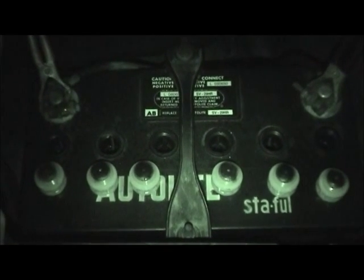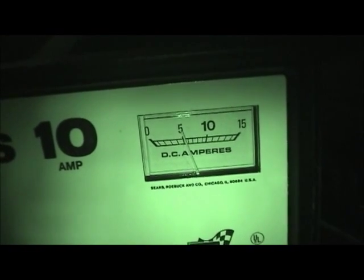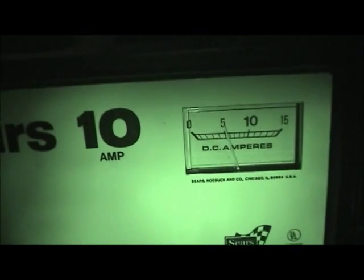That's pretty easy to see in this particular case. Had I not have these caps off of here, or if this were a maintenance-free battery where you can't take the caps off, you might think that this thing's in pretty good shape, because it's taking some current, or appearing to accept a charge. It's running about 5 amps right now. But that's actually deceiving.